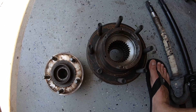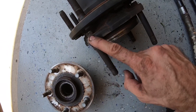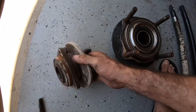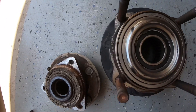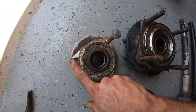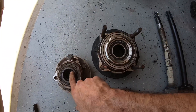One of the other differences is the way it connects to the hub. The super duty Dana 60 hub bearing uses four studs — they thread in on one side and get a big nut on the other side — four of them all around the hub bearing to install. Whereas the Dana 30 and Dana 44 only has three, and they're not actually studs, they're bolts, and they're considerably smaller than the ones on the Dana 60. So it's three smaller bolts versus four larger studs. Obviously the size of the axle shaft is way different too, and you've got eight lugs instead of five, and even the lugs are bigger.